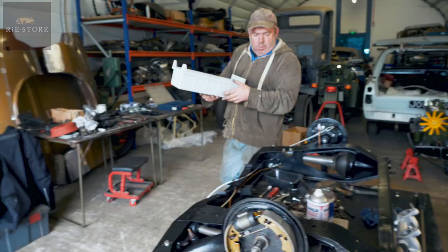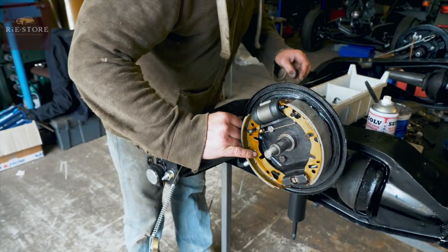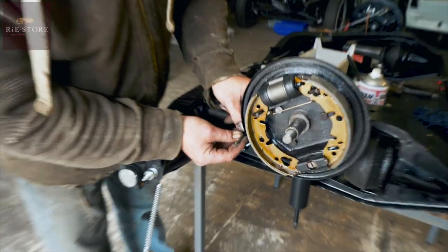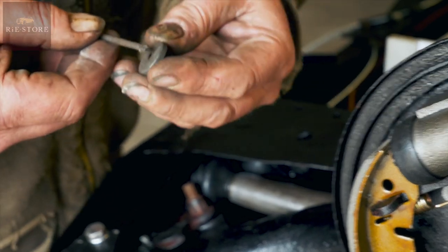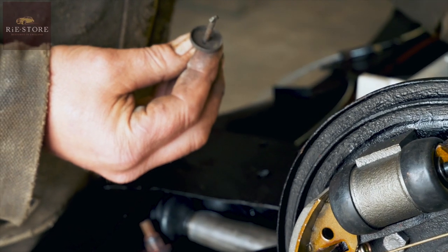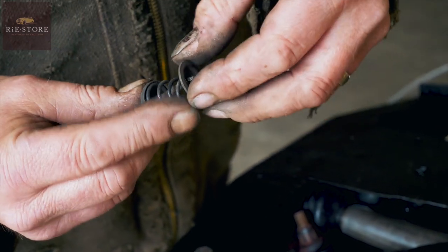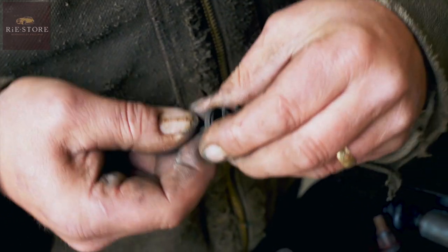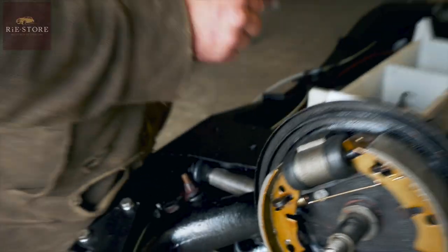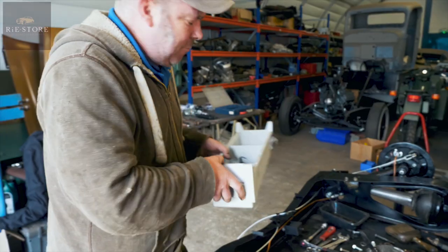Your brake setup basically. So what most brake shoes have is, pick up one and say that hole there, yeah? Okay. There'll be a hole in the back of the back plate that pin goes through. Comes through that hole there, yeah? Then you have one of them sits on the inside of the shoe, yeah? Then you have a spring sits in the cup, and you have one of them pushes on and just twists around to lock. And that would hold your brake shoe in there to stop it moving out. Okay. But yeah. Minis don't have them. Don't ask me why. Why don't they? I don't know. I just don't know. I think some of the later ones might have.